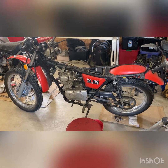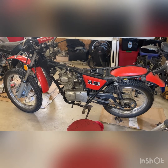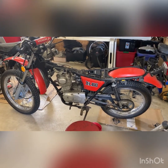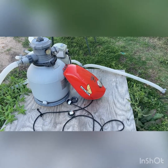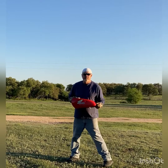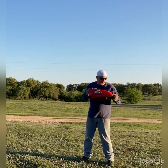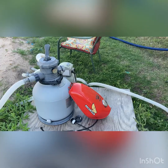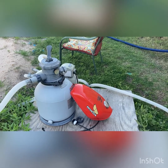I've had the cleaner in the tank for probably 4 hours now. I'm probably going to leave it overnight. I've got some bolts in, or nuts in there rather, to knock any rust loose. Every hour or so, I come out here and I rotate it, shake it around. Probably drain this out tomorrow morning, give it a good rinse. Then I can start on the next stage.